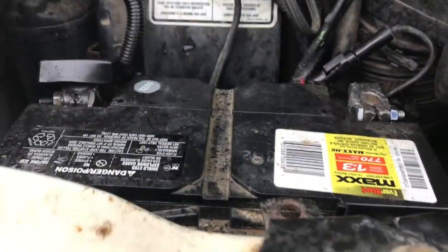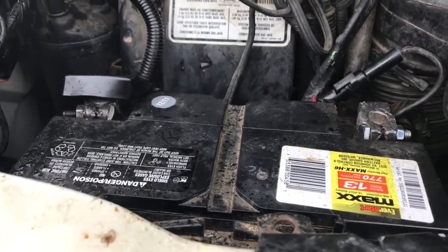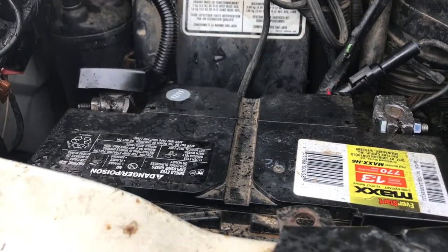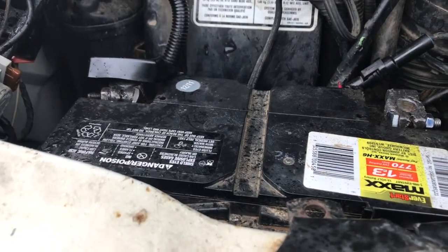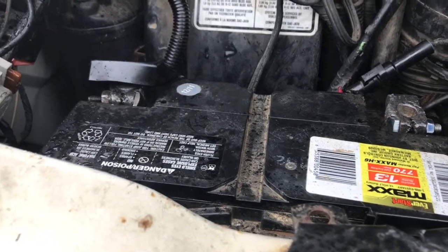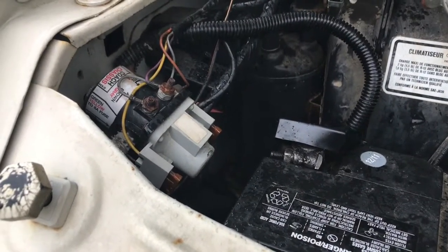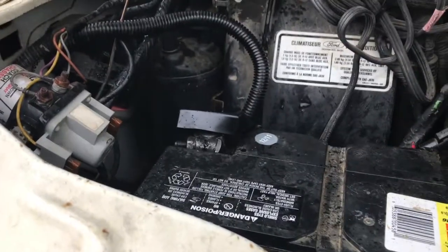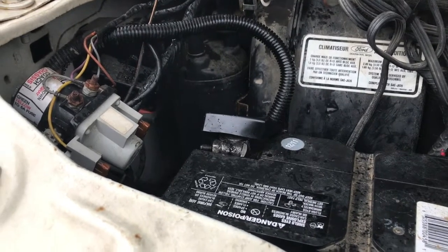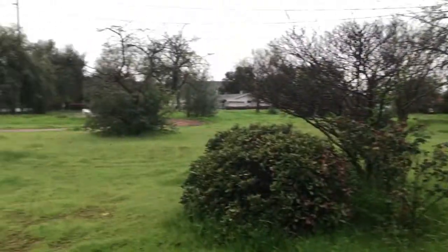But I tried to fire up the engine and it is still not working. Same problem as before. You turn the key and there's just one loud click and nothing. Nothing's turning over or anything. So even though this battery is now fully charged, it's still not working. So it's not the battery. The next thing to look at is the solenoid, and then after that we'll look at the starter. Mark says he doesn't think it's the starter because you can hear the starter engaging — that's what that loud click is. So maybe it's the solenoid. I want to message Mark to see what he has to say. It's raining right now so I'm going back inside.